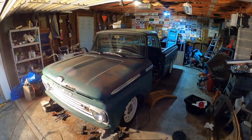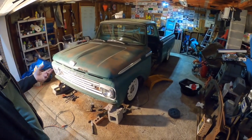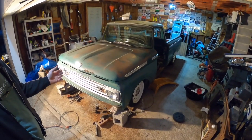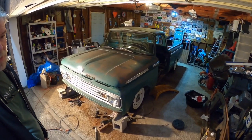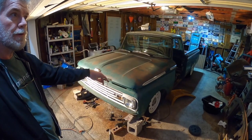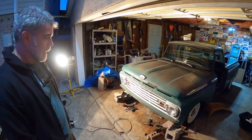So I say we'll call that a wrap for this video. That's showing you all the places as far as on the unibody 63 going on a 2009 Crown Victoria. We've shown you all the little places we have to cut and where we move the bottom radiator, how we reattach that bottom part that we flipped around. Then we ended up drilling a couple of holes, moving it back, and mounting it with some bolts we welded in there to put in place for that to work.